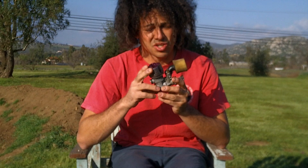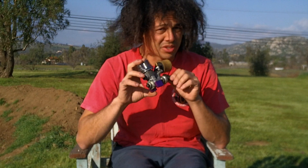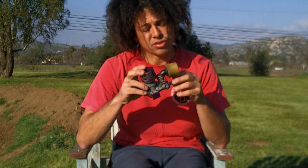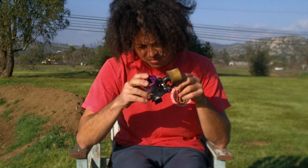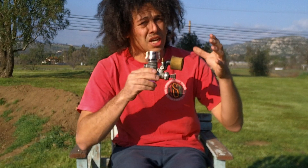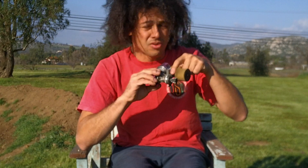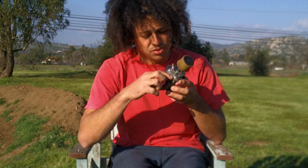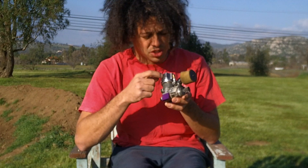This is what's in most RC cars and trucks today. A nitro engine is a two-stroke engine, which means that it takes two strokes of the piston to complete an entire engine cycle. As the piston is traveling downward, oxygen and nitro is sucked into the crankcase, through the carburetor, and then into the induction port, and finally into the combustion chamber.